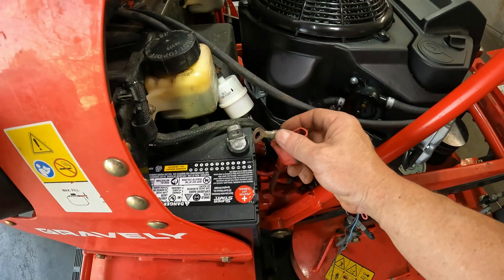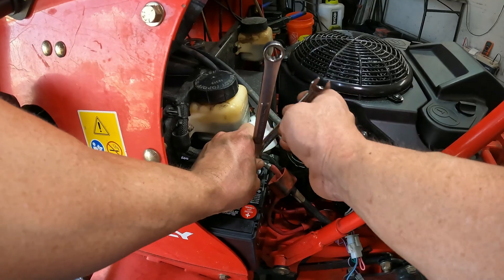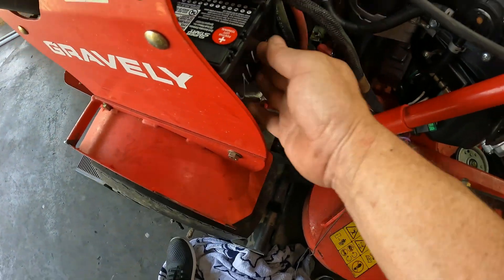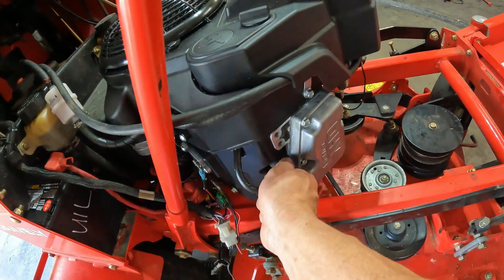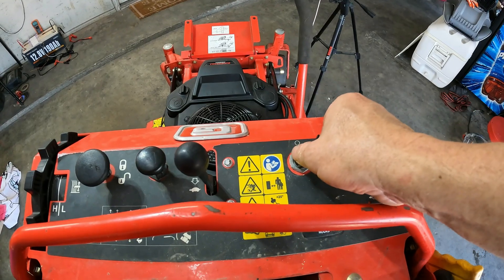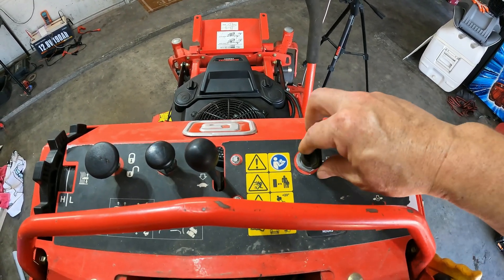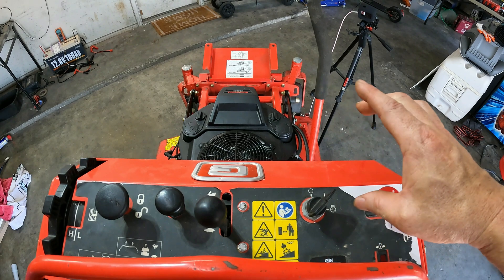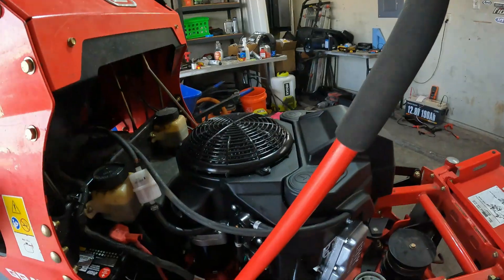Tap it and make sure we don't have a short — and that's popping. Looks like some kind of battery tie down goes there, probably just zip tie it. We're going to test the starter solenoid first and sort of prime the engine — get some fuel in it. Just pull the plug wires off. Fuel solenoid, PTO — and we're just going for cranking. Alright, so that works. Plug these wires back in.